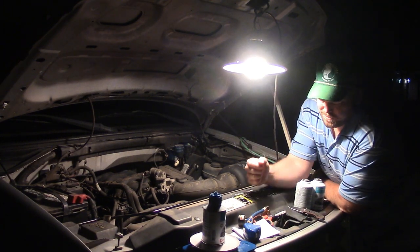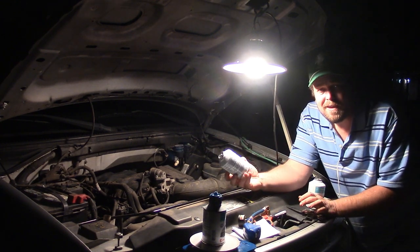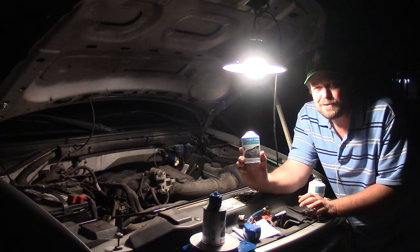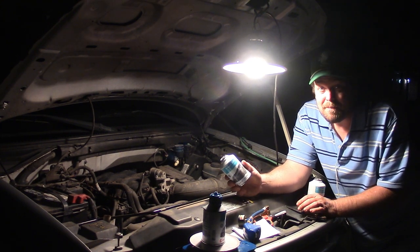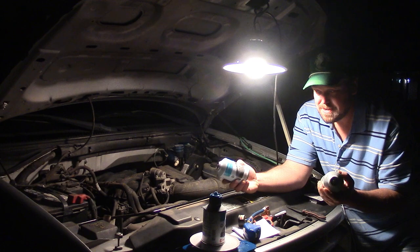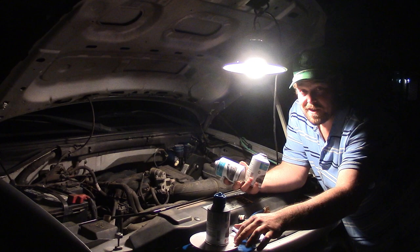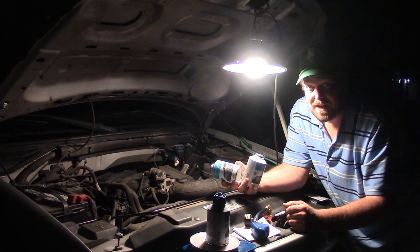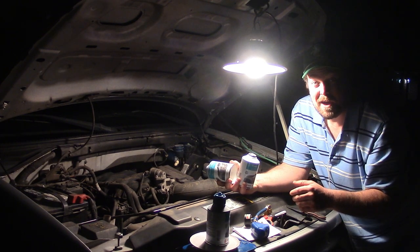I just spent the last three hours putting R134A into my F-150 and no one tells you how slow this is. There's lots of videos on how to do this but it goes slow. We started from a static pressure of 15 — that means there's no liquid left in the system, so it was almost completely empty. We ran through two cans completely and one partially. I used a kitchen scale to try to get a little more accurate, but based on my math I did overcharge it by about an ounce and a half.